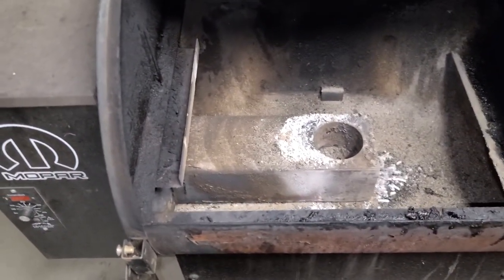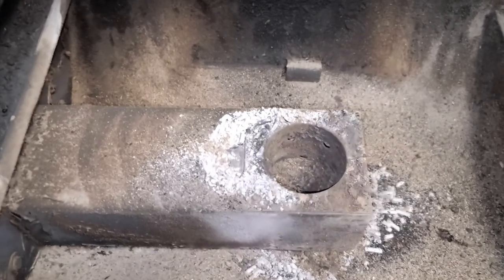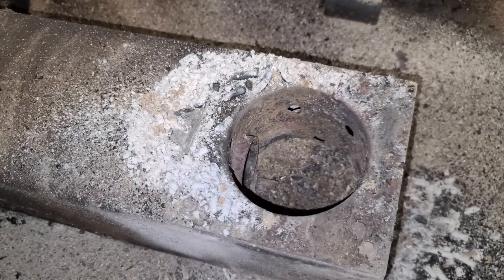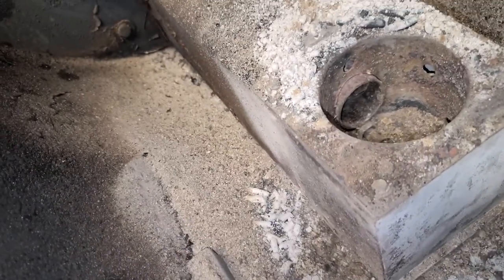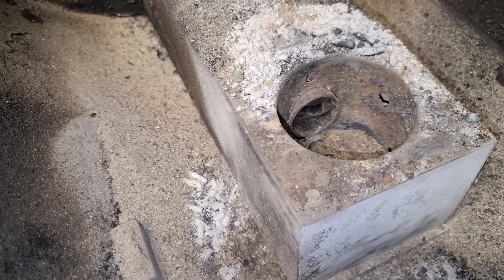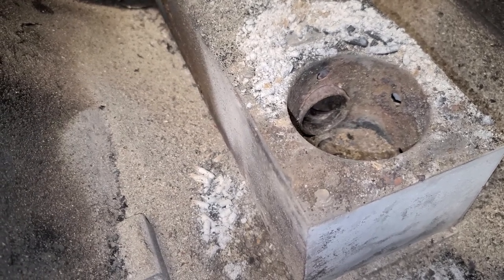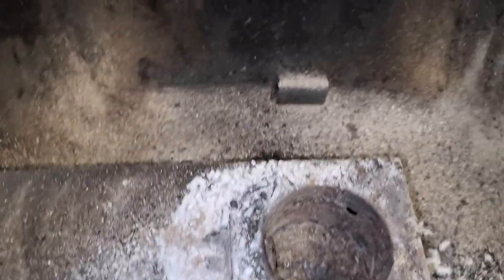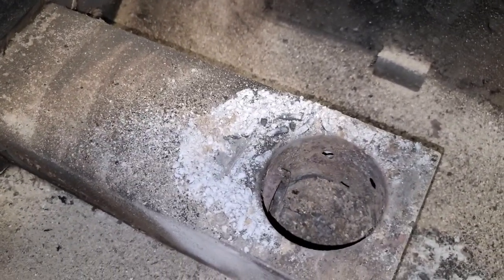What I'm going to do is plug this in and get that auger spinning and have it all push out into my bowl here. Once I get all that stuff out I'll go ahead and vacuum both sides of it, run it again, and see if I get any more junk out of it so I know it's clear. I got it plugged in now, I'm going to crank this thing all the way up on high because I want to crank these pellets or whatever the heck is in there on through the auger. If it starts to smoke I'll shut it off. My auger is turning. I'm going to shut it off before it starts to heat up and I'll do that again until I get stuff out.